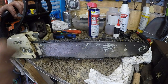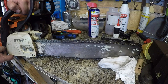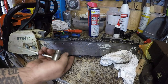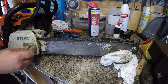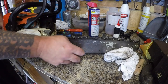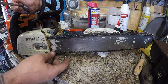What I do with all of mine: tighten the chain up to where it needs to be, then put a cloth down and push the chainsaw down so that bar is forced up. So all that slack is now at the top — you see it? Now tighten your chain up fully, keep that pressure on, and then tighten up your guard. It doesn't have to be stupidly tight, just on there. By doing that, as soon as you hit your first bit of wood, that bar cannot go any higher and that chain is perfect. If you don't do that, your chain will always be slack.